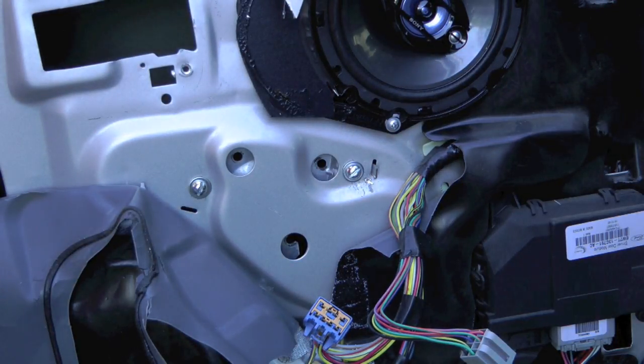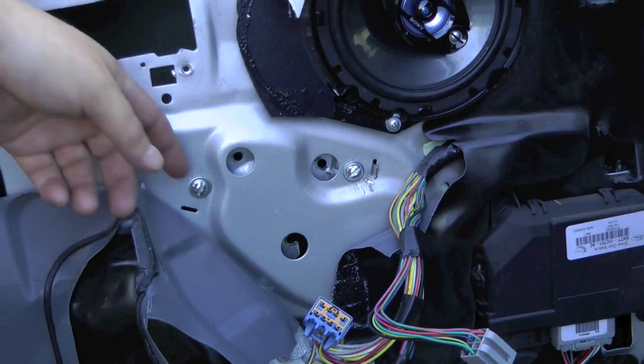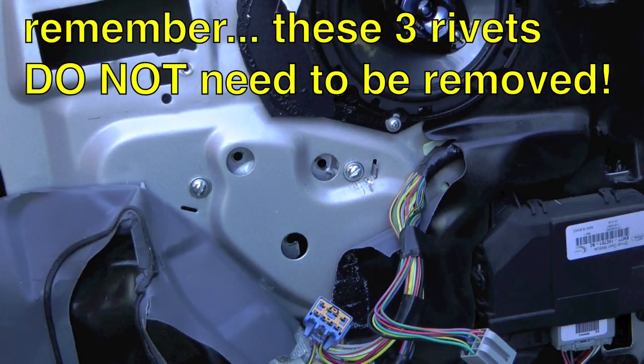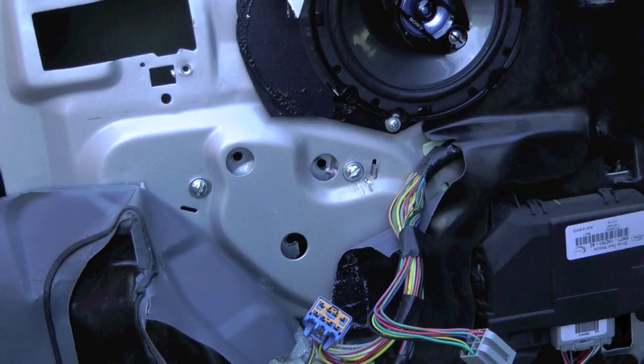So I opted for some nuts and bolts and washers, and I'm gonna Loctite the back of these, but that should hold up just as well as a rivet, and actually it'll make it easier if I ever have to disassemble. Drilling out rivets is messy, as you saw. But just wanted to share that, because if you get into this thinking, oh, well, I have rivets and I have a rivet gun, you may find that it doesn't fit your rivet gun.